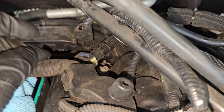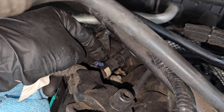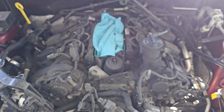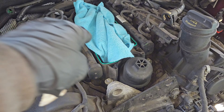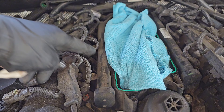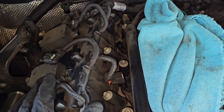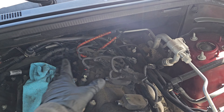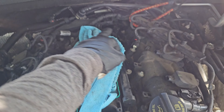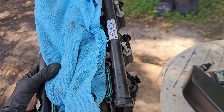Now we have a fuel line. The fuel line has a blue locking tab — go ahead and pop this blue locking tab off. Then take a rag, push on that white pin and remove the fuel line so we can remove this — actually that would be the lower intake with the fuel rail on it. Before we can do that, we have to pop those injector connectors off and move the fuel line. I disconnected the connectors off the coils and fuel injectors and pulled the wiring back to give better clearance. Eight millimeters crisscross — let's undo those. Lower intake is unscrewed and coming off. Place this one on the table for now.